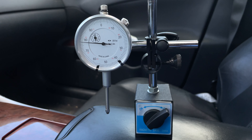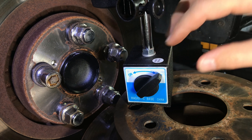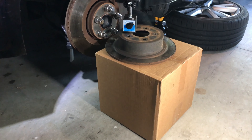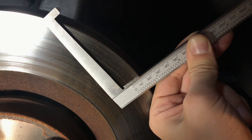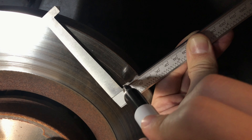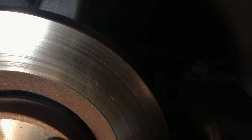If you're interested, links for all of the tools used in this video will be down in the description below. Set up the dial indicator tool — I placed mine on the top of a box and used an old brake rotor as a base. Next, measure run-out 10 mm or 0.4 inches from the outer edge on a smooth flat portion of the rotor.